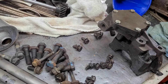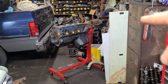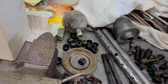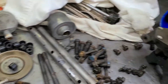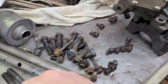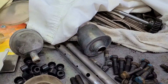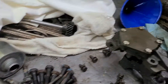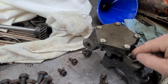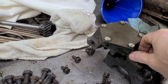This is from a 318, but it's exactly the same thing as the 360. So don't worry - 360, 318, these are both very common to those engines. You want to stick your bolts down in there - these aren't the bolts for it, but I'm just using this as an illustration. You want to stick your bolts down in there, run them down, torque them down. The bolts for this torque down to 30 foot pounds. This is not the bolt for this, so don't go hammering me in the comments.